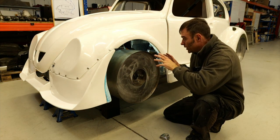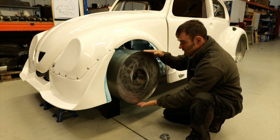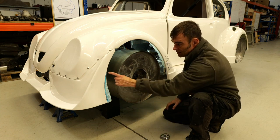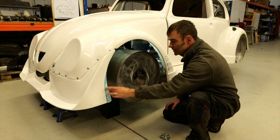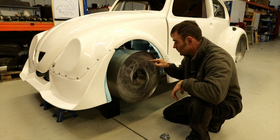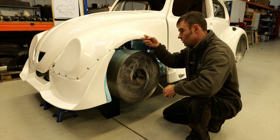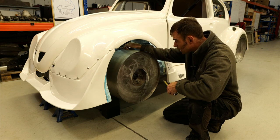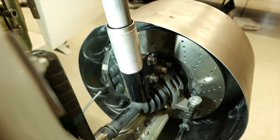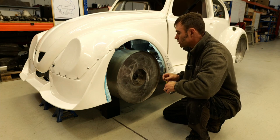Around at the front now - when working out your wheel sizes you need to make sure the suspension is sitting at the right height. Essentially this is now as if it was on the floor with the full weight of everything in there - the tyre would be kind of up here. The problem is number one we're going to have to trim some fibreglass, but the main problem is I wanted to go nine inch on the front because we've got a small Tesla drive unit in the front driving these wheels. With eight inch wheels in there's a massive overhang outside the wing and it's quite close to the strut inside. I've paused this to order some springs to see how much real term gap we're going to get.